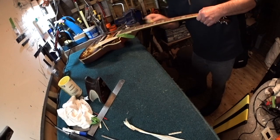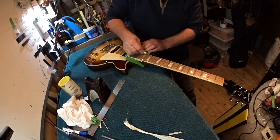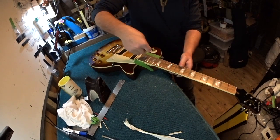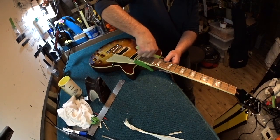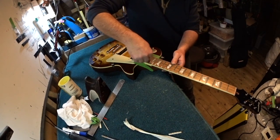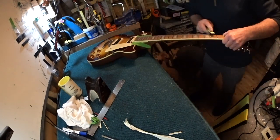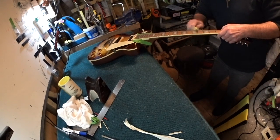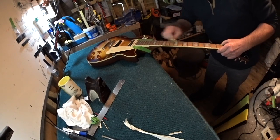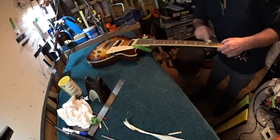This really does get rid of those last few burrs. Now this is quite difficult, so you want to get in there and you can either run it down, keep it a reduced length, or definitely keep it taped anyway. As you run down, make sure you don't run off onto the finish, and then get a fresh bit and run it down. It's quite flexible, so it's bending and going into the gaps as it goes. And again, be very careful as you come down to where the bodywork is.